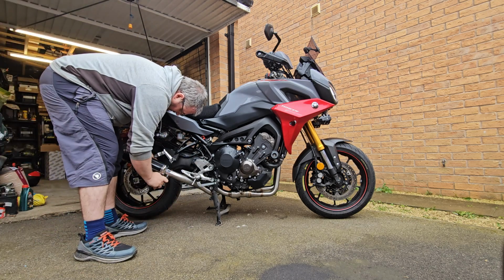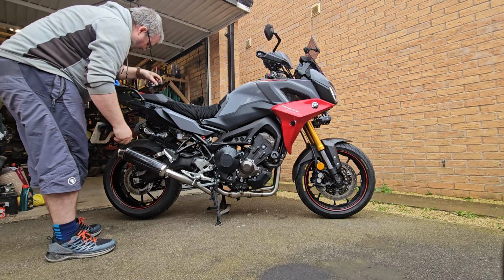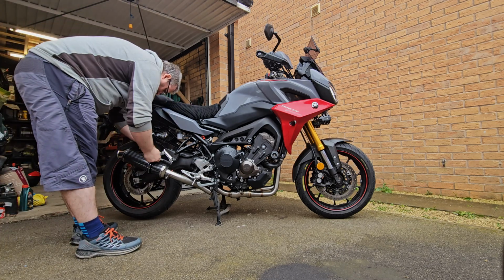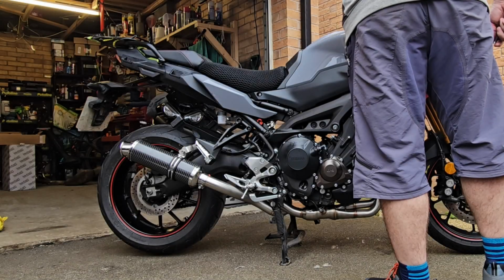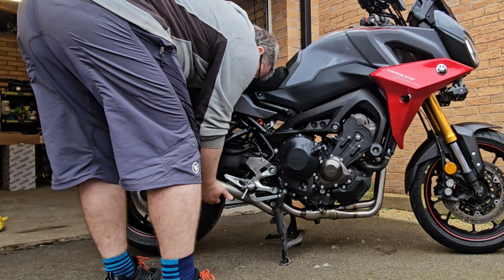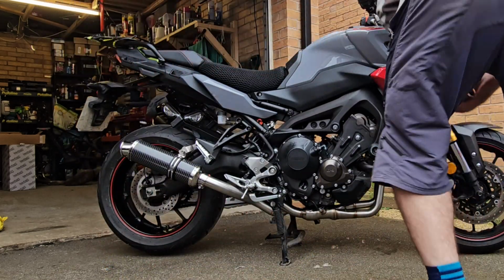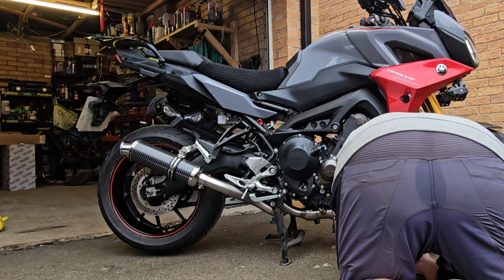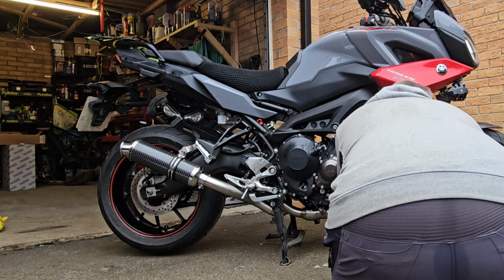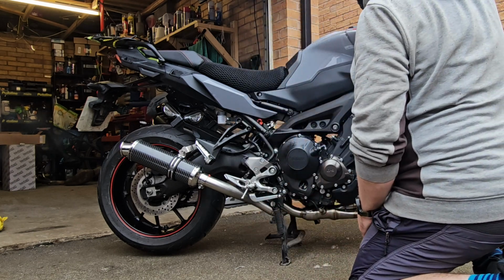Well, the heel plate. So loads of silicone exhaust sealant, tightened it all back up, put the hanger back on, put the strap back on. We'd tightened the baffle up previously, and we went for start number 2. And you can just hear that centre pot is just... I couldn't work out where it was coming from. And I'll warn you right now, them exhaust headers get very, very hot straight away. Like, ridiculously hot. The ones on the CB used to glow straight away. So it was a case of hunting the leaks.